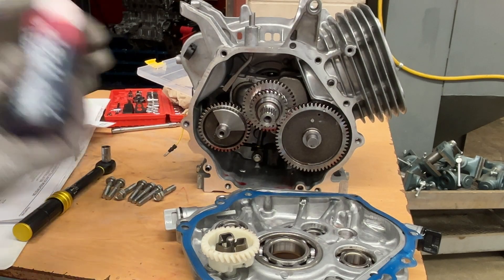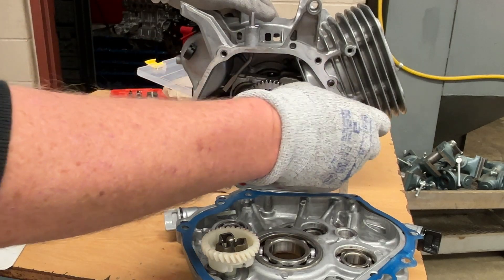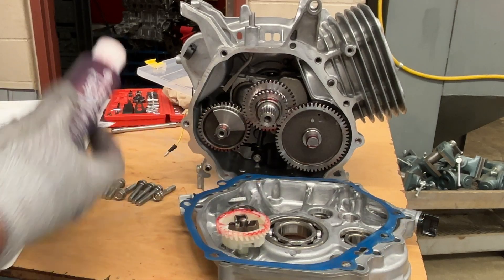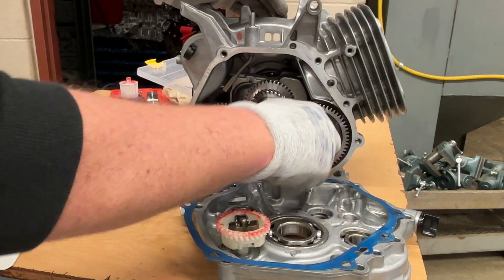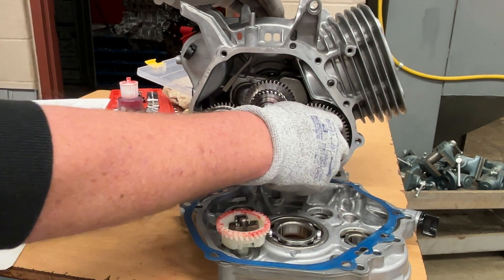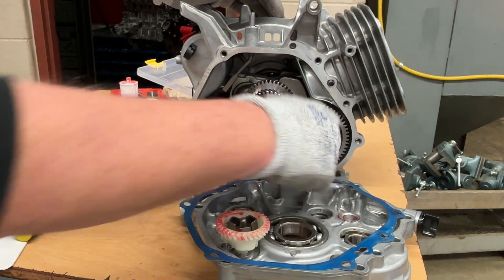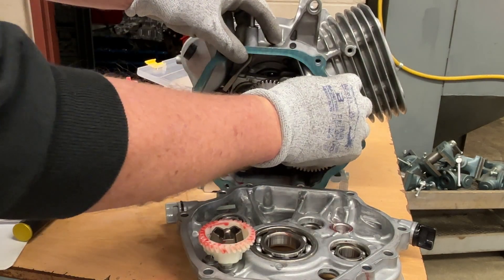Got those two in. Now we're going to prepare — this is going to be metal on metal. The other spot that we have to do a little bit of preparation is we've got to get a little bit of assembly lube on this governor gear as well. I'm going to get that assembly lube all the way around both sides. This one here, because it's just a bushing — not a bearing like these ball bearings — I want to make sure that I get that one nice and good. Then I'm going to install my gasket.